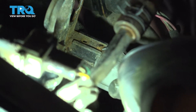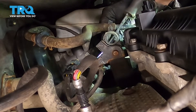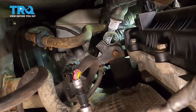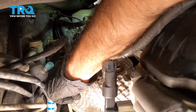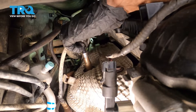Now these plugs have probably been on there a while, so they might not come off easy. Just a little patience — they will come off. So I have a pick tool; we're going to push down the center clip there and use a panel tool to pry and push the plug off of that metal bracket. Now that we have that free, what we can do is follow our cable and open up these metal tabs on the heat shield and pull our old O2 sensor right out.